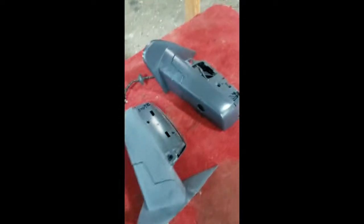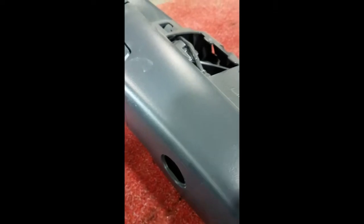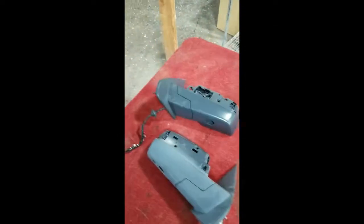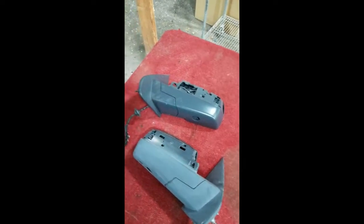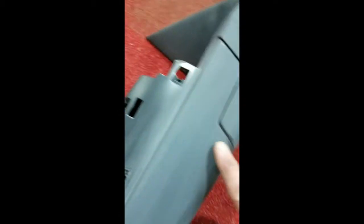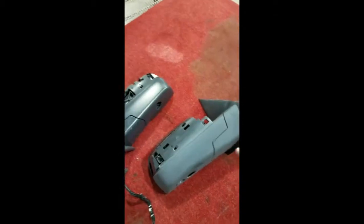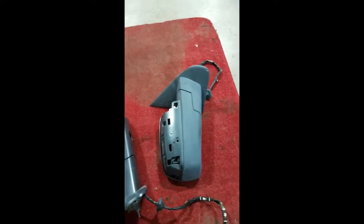But what I've done — if you can look closely, you can see the texture in the body itself. I plastic-prepped the raw plastic part of that and put a couple coats of sealer on it, let it get good and dry, and then came back and slick sanded the finish. So when we paint these things, they'll have a nice glossy flat finish on them instead of the texture.